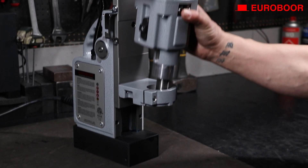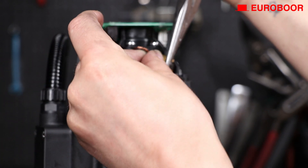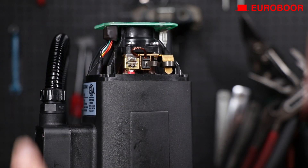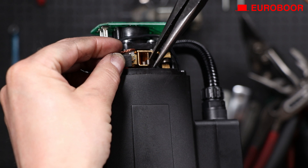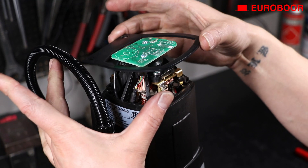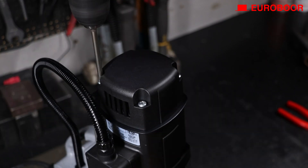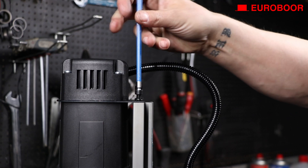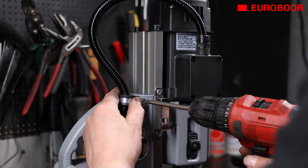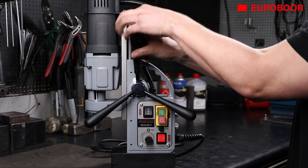For practicality, place the installation as seen in the video. Now reattach the carbon brush on both sides. Replace the fixing plate followed by the end cover. Fit the installation back into the frame and screw back the two bolts on top, and the one on the front if applicable. Finally, reattach the cable with a cable clamp in case your machine has an external cable, as well as the handles.